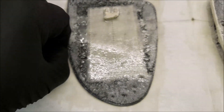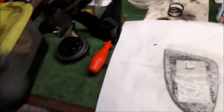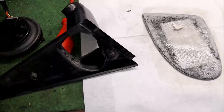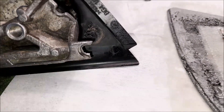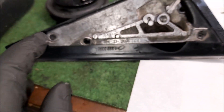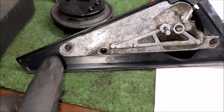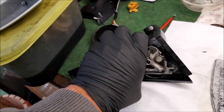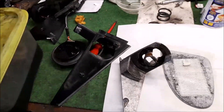Leave that for a good ten minutes. Let's get these little odd bits of foam out. When you take the mirror apart you will notice on the metal piece — once that is in there, it goes over these little pegs. Basically what's happened is these were little plastic towers and they put the alloy piece in there — clunk it in, it does actually click in. Do the same trick with this — squirt squirt squirt — and that should hold that in place.